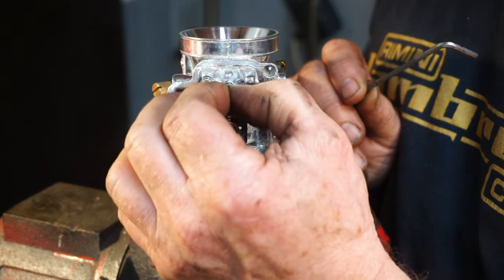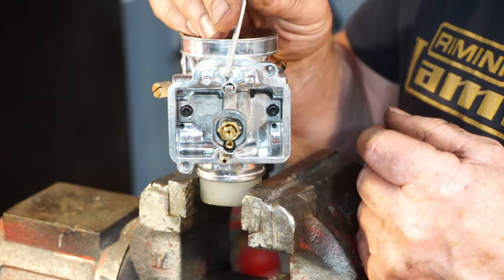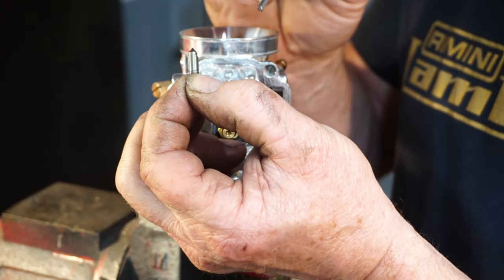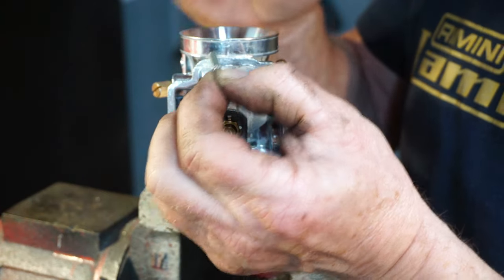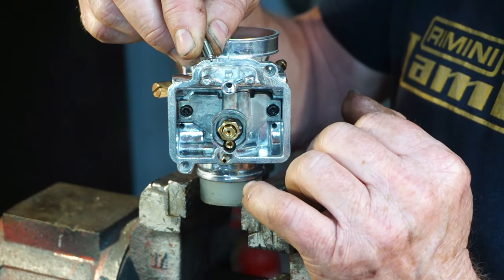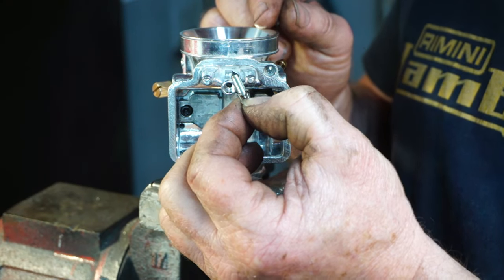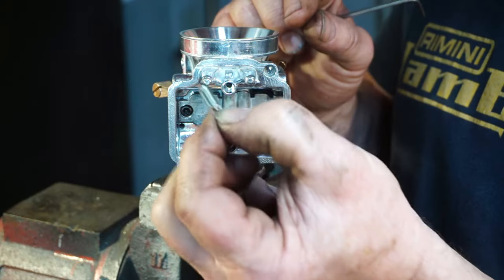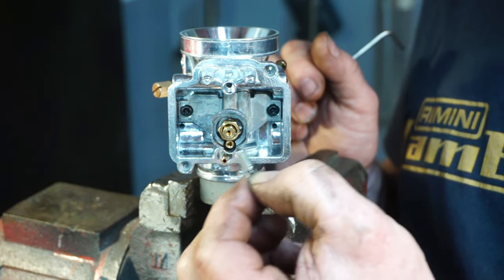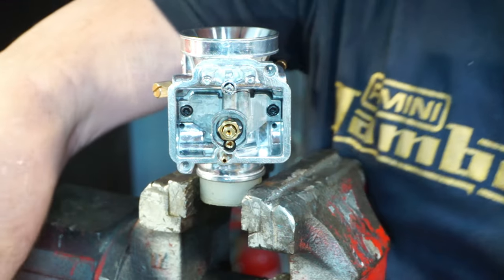This needle opens and closes a small valve. It works as a valve. You've got two holes either side here to let extra fuel out. You've also got slots down the side of the needle to allow fuel flow down the sides of the needle as well. Certain things, we might as well just comment on this now. This is a spring-loaded needle. That's very useful for engines with high vibration, because what can also create problems is if your needle is bouncing in the seating, the carburation will overfuel and you'll get overfueling. So this acts as a dampener when the float is in position.